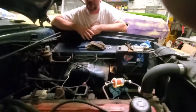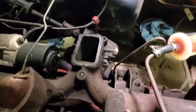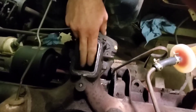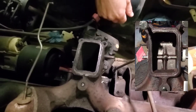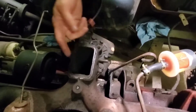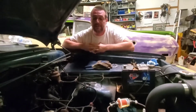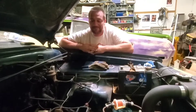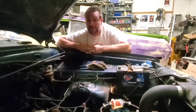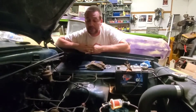And it's missing the heat riser in the exhaust manifold, which was one of my fears. When this thing was idling within about two minutes, you could start hearing the fuel boil in the carb. What's supposed to be in here is a flapper that blocks off the heat from rising through the exhaust manifold when it's running. When it's cold, it heats the bottom of the intake to keep the carb from freezing, and then when it warms up it directs the exhaust down the exhaust pipe. But it's missing. That's no good. So now we've got a decision to make — find an exhaust manifold, put a header on it, or figure out a way to fix it. If anybody knows a way to fix it, let me know, because this one is actually not cracked — it's a good slant-six exhaust manifold.